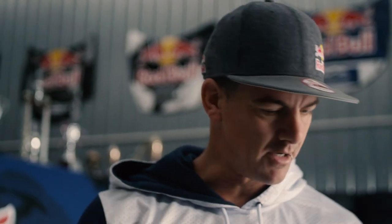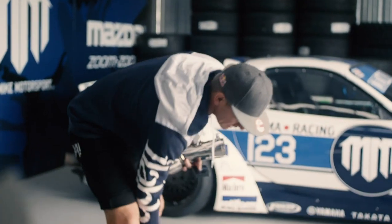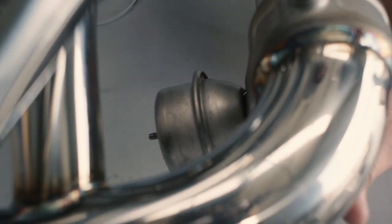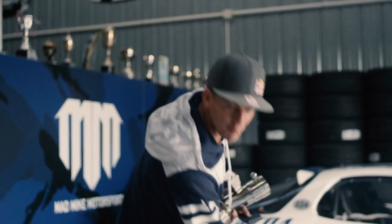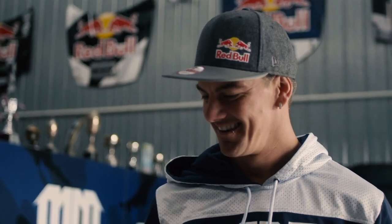We've got a little ECU — this looks like the little brain. We've got a little remote, so that just flicks the valve around. The vacuum is gonna pull that actuator, close off a valve, we'll open it up, and then make the exhaust gases either go the loud way or the quiet way. Simply push the button. Pretty freaking cool. But really this is probably pointless — yeah, because it's always gonna be on loud mode.